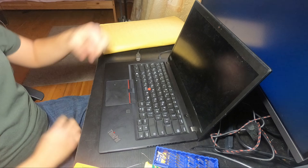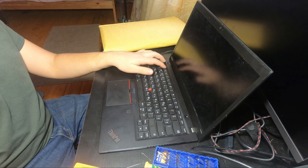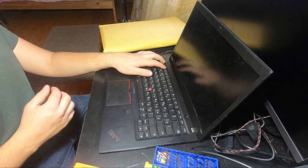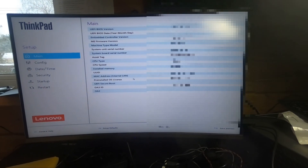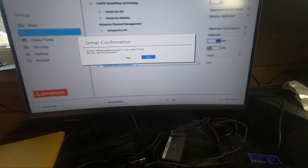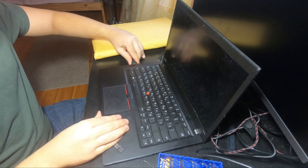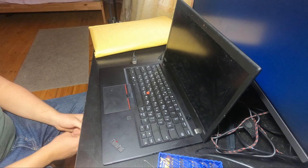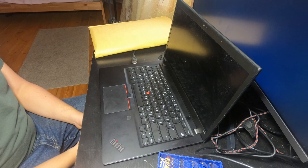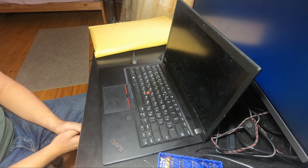Now our output is switched to the external screen. Plug in the external screen and turn the laptop on. Press F1 repeatedly until you hear a beep again. As you can see, our laptop is now using the external screen. We can navigate it as usual to disable the battery: go to Config, then Power, then Disable Built-in Battery and press Yes. Please note that you should disconnect your computer from AC power first. Our battery is now disabled — disconnect all cables and let's start the main part. If you don't have an external screen or your laptop is in text mode, there will be key combinations in the description so you can disable the battery without an external screen.